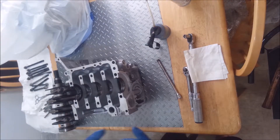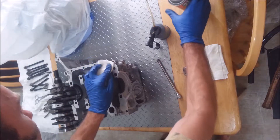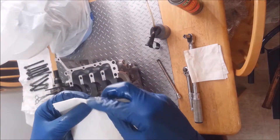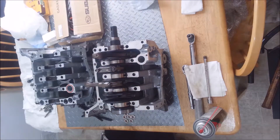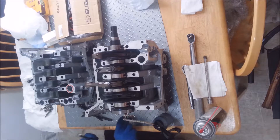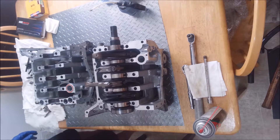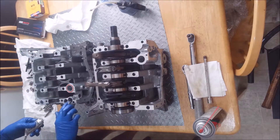Now before I put this crank in, I want to make sure there's no oil left on this surface because this is all going to get gasket sealed. I want to make sure none of that fuzz gets stuck in the block either. I'm going to put a little bit of oil on these two just to lubricate this seal — be real nice to them, make sure they don't get wrecked on the threads. I've got Permatex Ultra Grey for this — that's what everybody seems to be using, so that's what I'm going to use. Just want a small amount, and I want to try to keep it off the bearings.